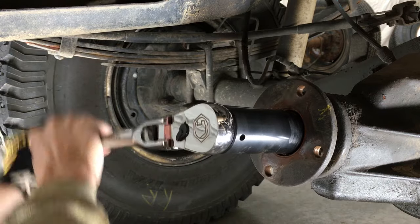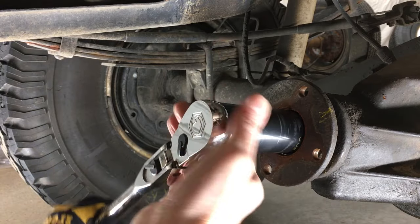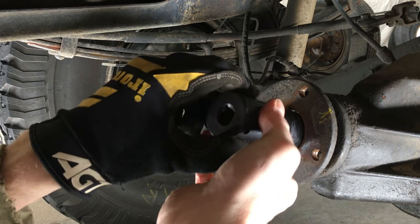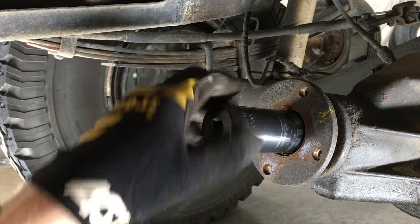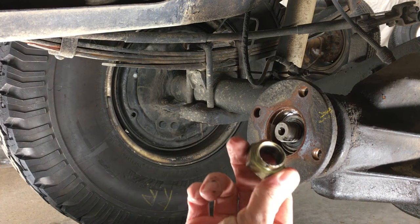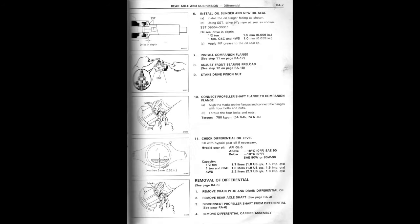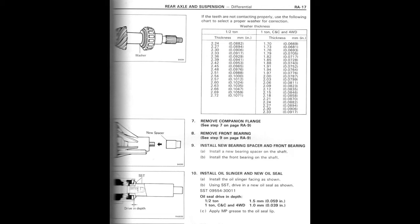Important note: count the number of turns it takes to remove the nut. Some trucks, including this one, use a crushed sleeve on the pinion. Some older models use a solid spacer. Rather than take apart the entire third member to replace the crushed sleeve and adjust the preload and retorque everything to 253 ft-lbs, counting the turns will let me get the nut back to where it was and then I'll just torque it back to 90 ft-lbs. That'll leave the crushed sleeve and preload as it was, saving a lot of time and labor. I've read about this method on numerous forums over the years and it keeps me from tearing apart the entire rear diff. If you want the full instructions for replacing the crushed sleeve, I'll put a link to the factory service manual in the description.